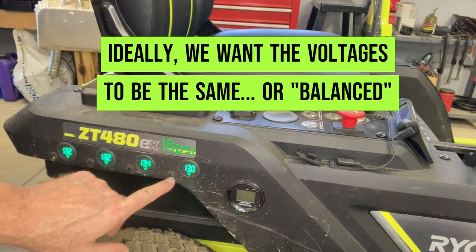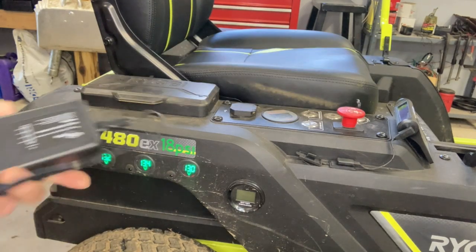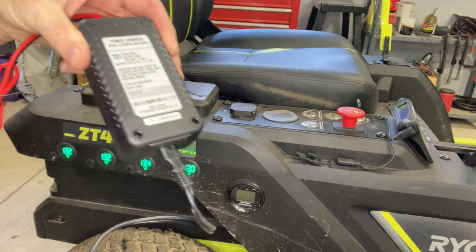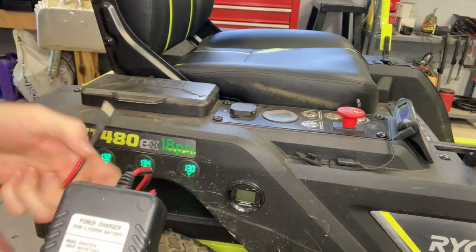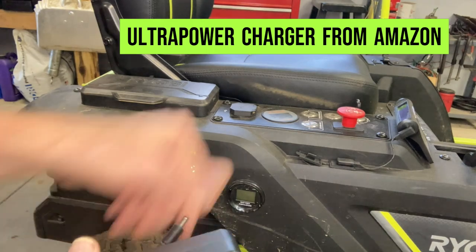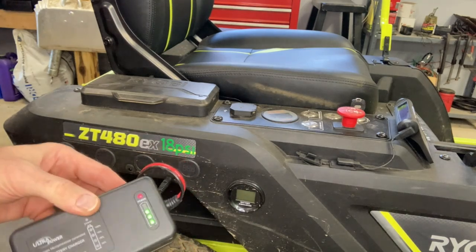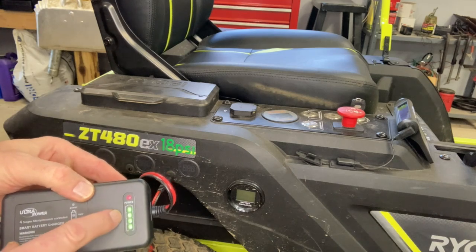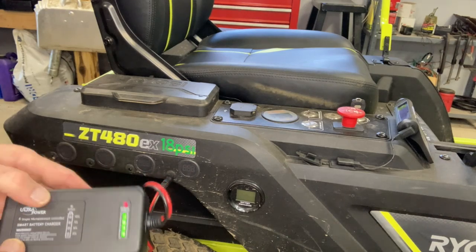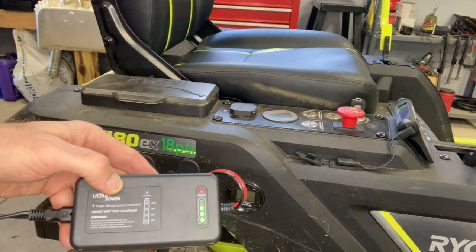I put in some charging ports last year, so I'm going to go ahead and put this battery charger in and see if we can boost the charge up on this one low battery. This plugs into 110 and it's got a standard DC plug. It's a 12-volt charger and it's just going to charge one battery. I'll turn the key off in case there's any crossover. It looks like it's at three lights and blinking for a fourth — so it's at 75% and going to 100%. I'll leave that on for a while and check it again in a bit.